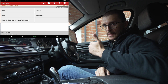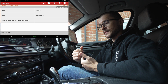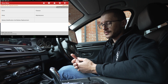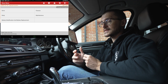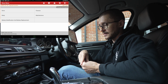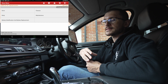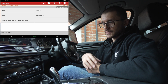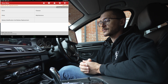To summarize: we've seen how to check voltage when starting the vehicle under load, how to go into the servicing menus to see at what charge percentage range the battery has been used, and how to check if a new battery has been registered and when. All of this gives a nice overview of what is happening with the battery. Correlate that information with the actual battery in the vehicle — has it been changed or not? Also keep in mind that the vehicle will give you warning messages well in advance of the battery becoming unfit for purpose, as the system is quite conservative. Many people continue driving long after those warning messages appear on the dash.